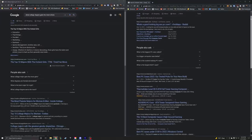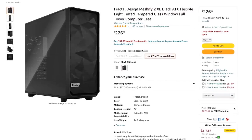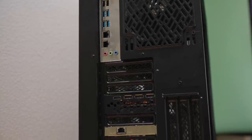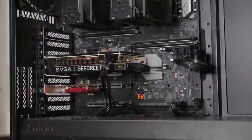After spending more time researching cases than I did picking my degree, I ended up with the Fractal Design Meshify 2 XL — the exact case I'm using in the other room for my main server. It's got nine PCI slots, which is the exact amount you need if you want this board to line up properly and not lose access to any slots. Find me another nine-slot case under $200. Exactly. That was annoying — I had to drop $200 on a giant-ass case, even though I had like four EATX-compatible cases just playing around. But it all fits nicely now and boots up fine.